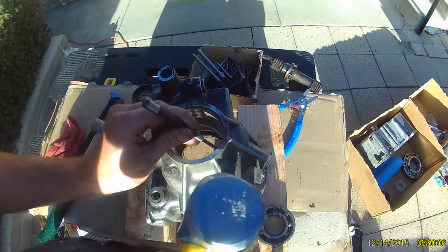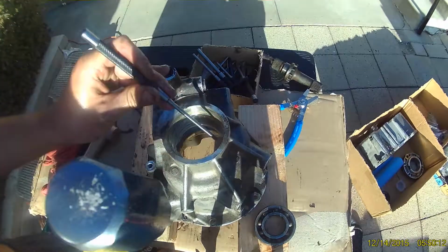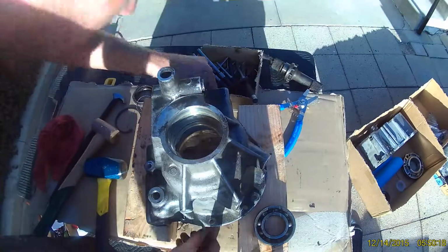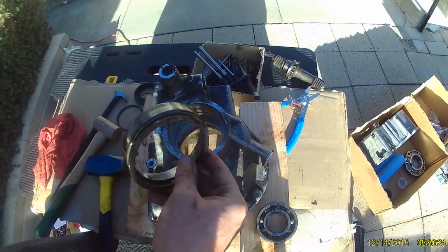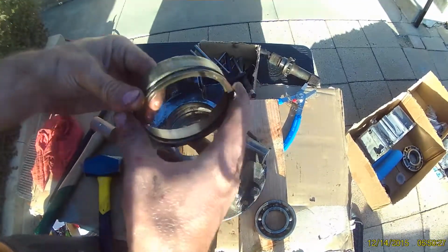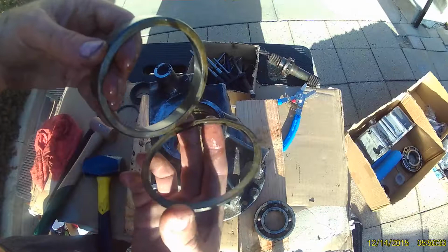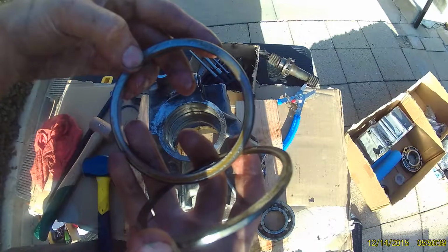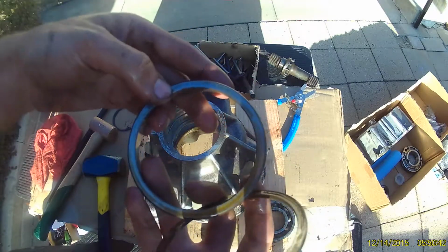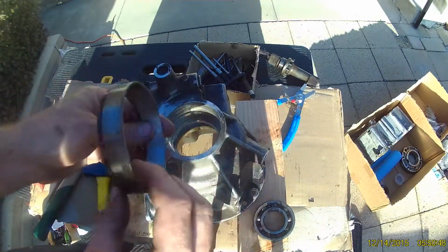There's a spacer in there. There's also a shim in there with the bearing, so you want to keep these together, and we'll have to experiment on the rebuild onto which shim will work the best. It's kind of annoying because we'll have to punch this bearing in and out again. Got a Timken here, Y32011XM, made in Poland. Concave faces inwards.